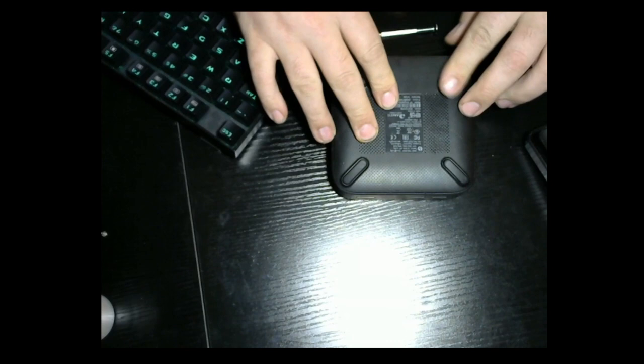Alright, now that our Chromebox is fully reassembled, we'll head into the next step, which is getting this bad boy in developer mode so that we can write our new firmware script to it. Okay, so I have all my peripherals plugged in, my screen, my keyboard, and my mouse. And I got it up on its side here because at this point, we need to push the reset button on the Chromebox, which is located on the side. It's a little tiny hole that you're going to use your SIM tool or paperclip to push the button with.